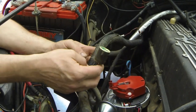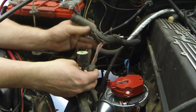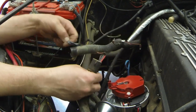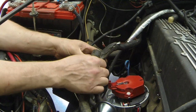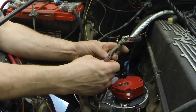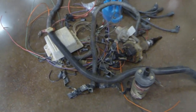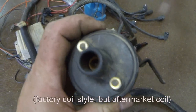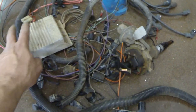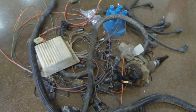What we're going to do now is remove the original distributor wire — the one that was really corroded. Since we don't need these wires at all anymore, we're going to take apart the harness and remove these wires all the way over to the ignition module on that far fender — that'll clean up the engine bay. We'll get some new conduit and tape and get this thing back in good working order. As you can see, we've gotten rid of quite a few things: there's a pile of wiring, the factory coil — the plastic's burned up, as well as the center electrode — the distributor, the ignition module that was over on the fender, the cap, wires, and all the wiring related to the Motorcraft ignition that was on the Jeep.